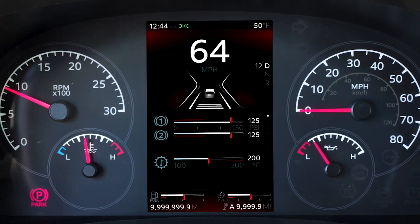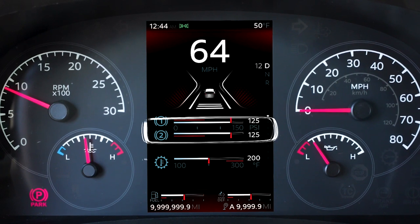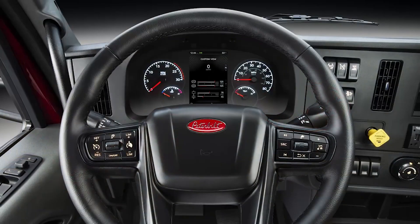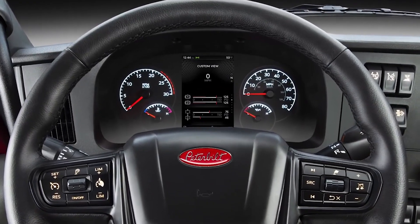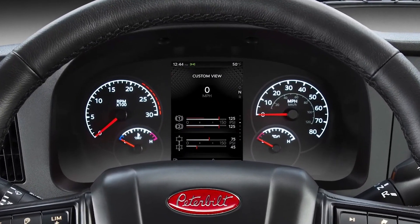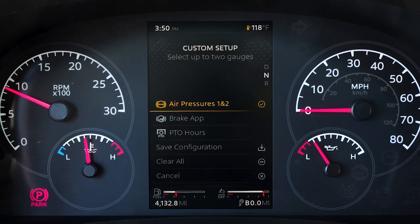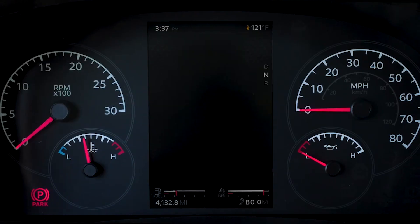When the parking brake is released, the display will show useful driving information, minimizing the currently selected view and removing its label. A gauge view presents the standard and optional virtual gauges monitoring your truck systems. Two single or two compound gauges can be shown per view. Each view is ranked by importance: primary, secondary, and additional gauges. Vehicles with the custom gauge option provide a view which can contain up to four operator-selected gauges. If the custom view has not been configured, the operator can use the custom view setup: scroll and select the desired gauges, then press save configuration.